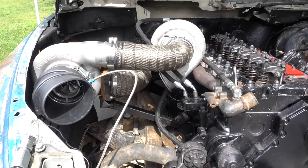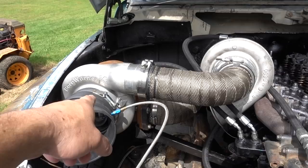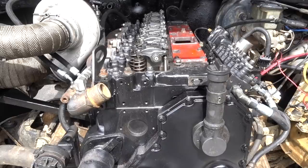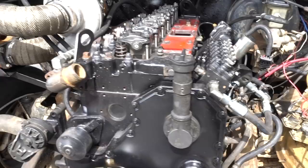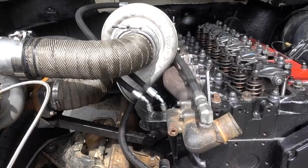The camera didn't get turned on as much as it should have, but both turbos and the manifold charger are on — the second charger and the hot pipe and cold pipe are now on. Both feeds are on. We made up a new drain for the manifold charger and might reconfigure them. We still need another fitting, need to set the top end and do all the valves like we did on the first gen. The coolant pipe and plate are on, and John and James got the converter bolts and flywheel bolts all done. Engine mounts are tight — we're getting close.